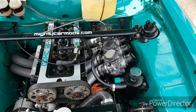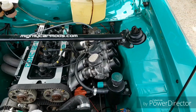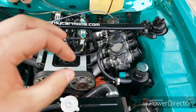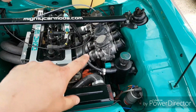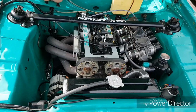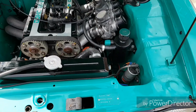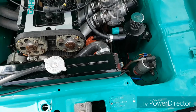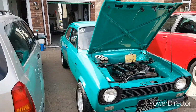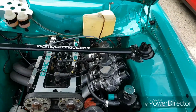Right, so welcome. I found out what the problem was. On these float bowls there was the little screw which is for the drain point underneath. It was actually cracked, so we did a weld repair on number 1 and 3. The engine's all in, it's bolted up, everything's done. I put all the split pins in on the TCA arms, all the fluids are good, and she's out the garage. So yeah, happy days. She actually drove out of her own steam.